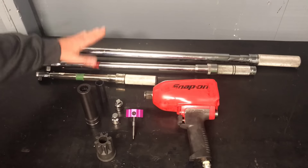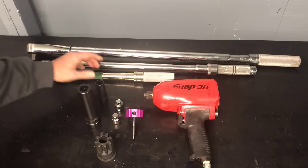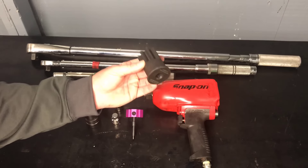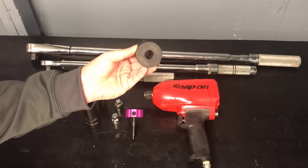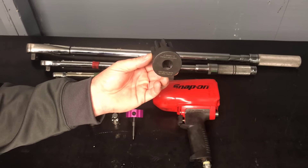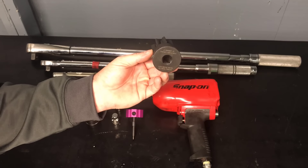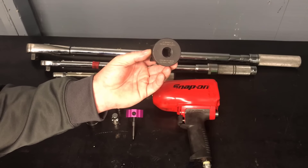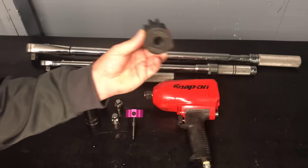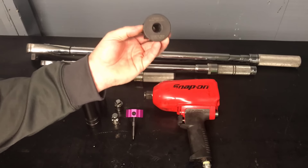For putting it back together, you're going to need a three-quarter inch torque wrench, a half inch torque wrench, and a three-eighths torque wrench. Another specialty tool you'll need is an engine turning tool — this is the Cat one. It goes into the side and onto the flywheel, and this is how you rotate the motor over when you need to get the pistons out. Big trucks don't give you a crank bolt up front, so this Cat turning tool is definitely something you need if you work on big diesel trucks.